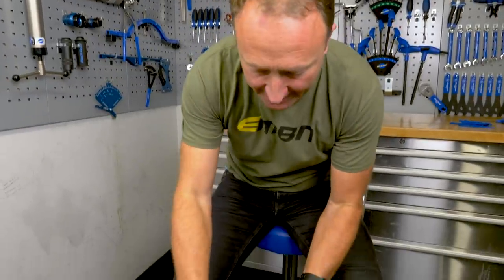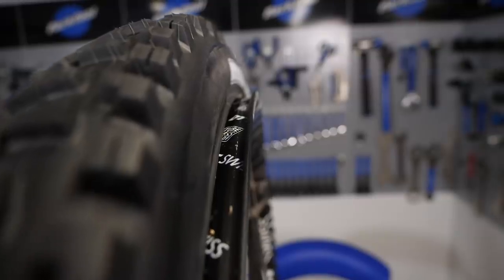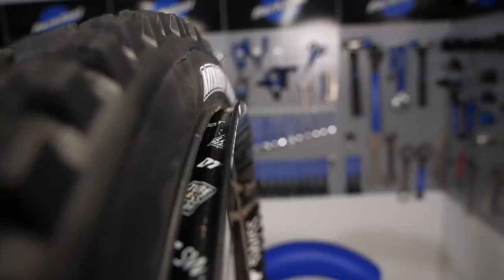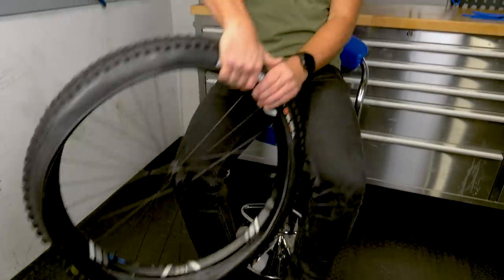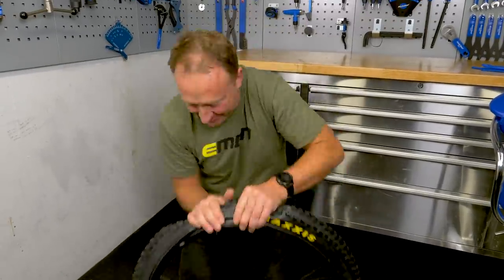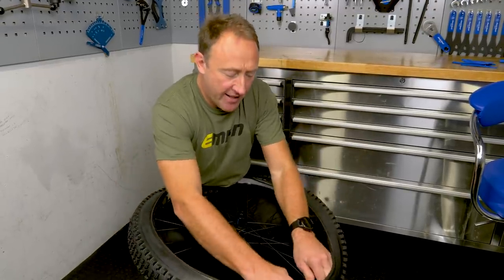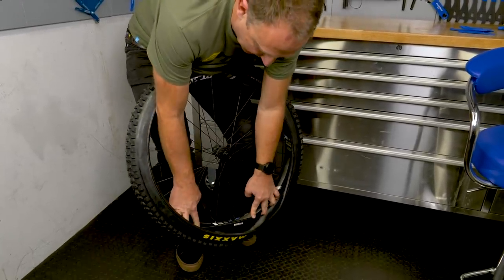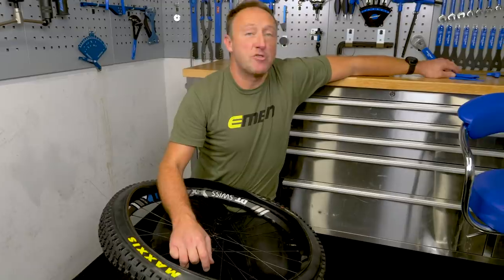What I'm trying to do is get the tire into the central part of the rim, so it gives you as much room for maneuver as possible. On she goes. You should not need any tire levers when doing this first part. Now this is actually quite physical. I've had a one-minute arm wrestle to get 90% of the first bead on. However, as you can see, it's only gone so far — I've got about 200mm remaining. At this point it's time to reach for the levers.